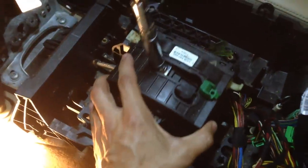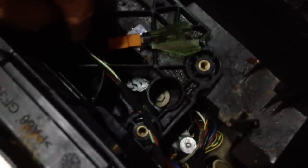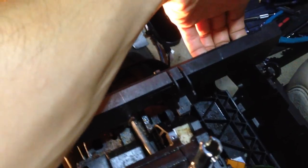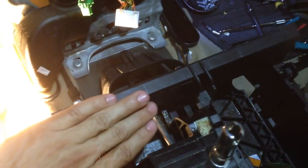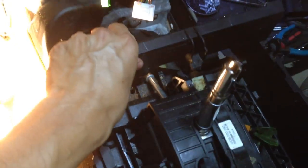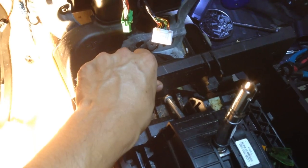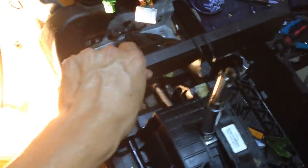After you do that, you have to unbolt the shifter — these bolts on the four corners right there. After you take that off, you have to take this saddle that the shifter sits on. You can see the bolts right there. After you unbolt those, you have to unbolt this casing because it holds your radio and components — this whole length of this lip is stuck underneath here and won't come up without this out of the way. So what you do is pull this up and out, then pull it back out, and then you can take out this plastic casing.